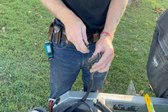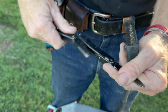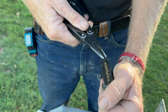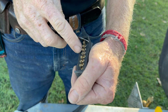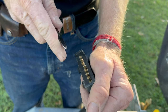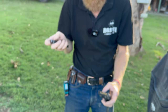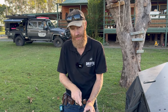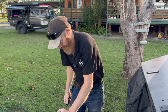And what to do, you get your pocket knife out, and what happens, the pins get pressed in like this, see, over time, and then they're just not making contact. So what you do, you get your knife out and you just separate them gently like that, and that spreads them out. 90% of the time when you've got something not working, a left blinker, right blinker, it's because of those pins, and you just do that and they'll work again. All right,